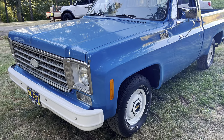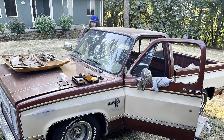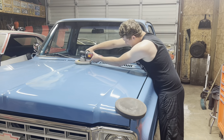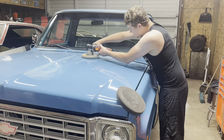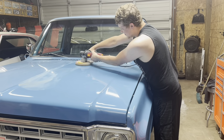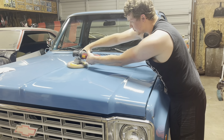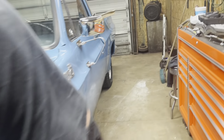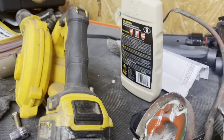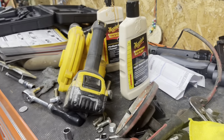What we have here is putting a little shine on the hood on the old '76. The paint is really oxidized bad. Just using an orbital polisher here with some medium cut cleaner — Meguiar's — and then we're following up with some swirl mark remover. That kind of blends in the scratches, and then we'll wax it after that.